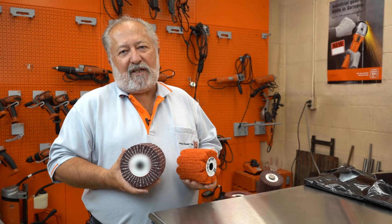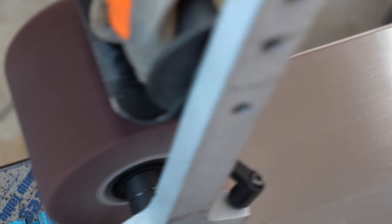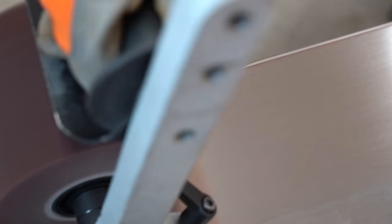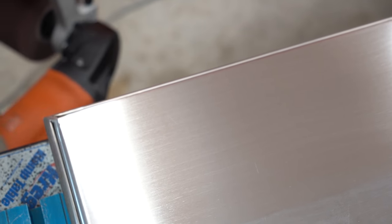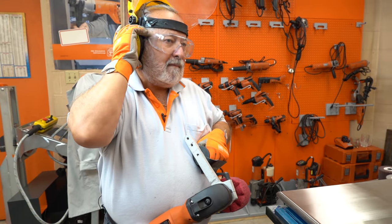After feeling the scratch, I've determined it's approximately a medium scratch. Because of that I'm going to start with the mixed wheel to grind out the scratch, with the fleece blending it in. I start at speed setting number four — never at six. If the scratch is still there, I'll keep it at four but exert a little more pressure. If it's still there after that, I'll move to speed setting six with just the weight of the tool and light pressure, then inspect again. By that time the scratch should be gone.